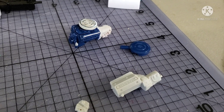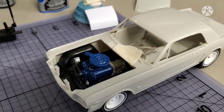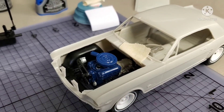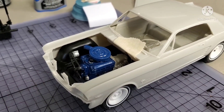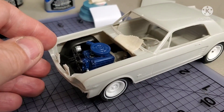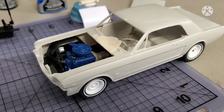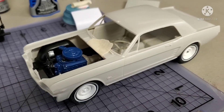That's the engine plan. Now we'll show you the engine sitting in the car. This engine sat a little too high in the Mustang, so we had to take a little bit off that fuel filter piece at the bottom of the fuel pump. We also took a little bit off the cross member in the Mustang so it would sit lower. The body needs a shim because it actually sits too low and wants to ride down on the fenders - it'll need a little shim work to fit right.